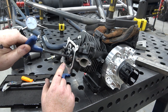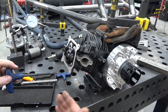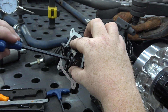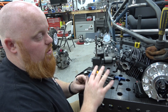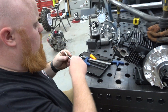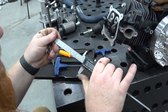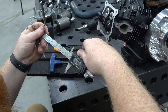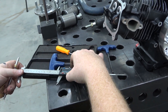I'm also keeping my rocker adjuster pretty much zeroed — you don't want it sunk in a ton because then you're not getting the most length out of your push rod. I would rather have more length in the push rod instead of adjusting out the adjuster a lot. We're setting our valve lash at zero for this measurement — just get it snug enough where you can move it but it's not pressing on the valve. The total length reads 5.235, so we're going to go to 5.245.